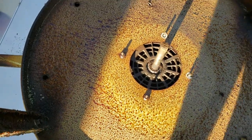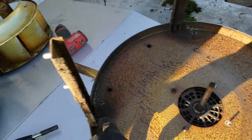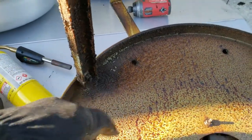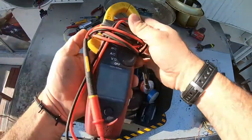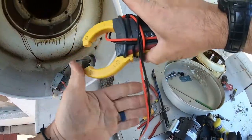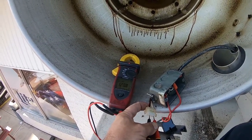When it was powered up, that's when it would seize up and just lock into place. We checked the capacitor and that wasn't the issue. We're going to make certain our voltage is 115 volts, because about the time you don't, you wire it all up and then have to change it all back. We're reading 121 volts — good to go.